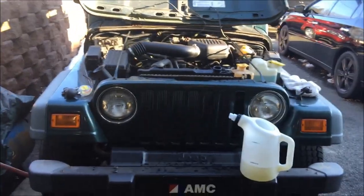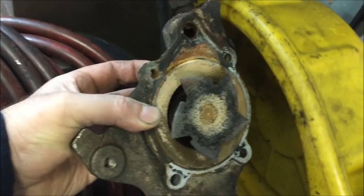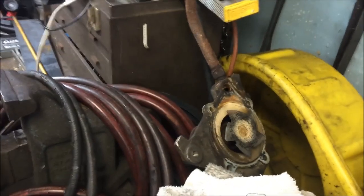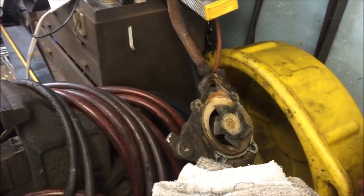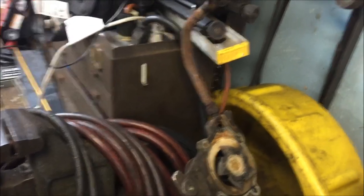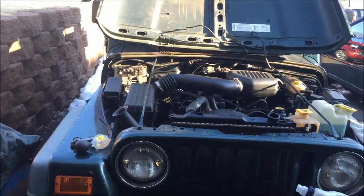So this whole time, no heat was basically this over here. There you go. That's the culprit right there. So if you're going to flush out your antifreeze, your heater core, and you get water going through but you still don't have heat, what I mean by water going through both sides of it, you're putting water in one tube that's sticking out of the firewall into the engine bay, and the water's flowing easily out the other tube, the one below it, then yeah, heater core is good. In my case, it turned out just to be a crappy water pump. Original water pump with 144,000 miles on it. So at any rate, we're all done here with this video.